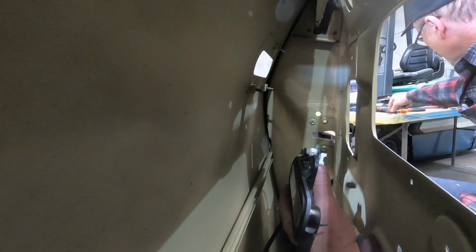It sounds different to a normal coupe. I think a normal coupe or a normal Falcon has maybe more of a mechanical sound, which I do like. But because this has got the Mustang latch, it has a lot of plastic components in the latch. You can't really see it from there, but it feels like a plastic latch. It's a steel striker, but a plastic latch. I still have to do filling and stuff inside the B pillar, but that's all fine. There won't be much work involved there.